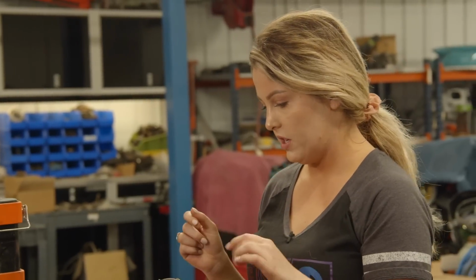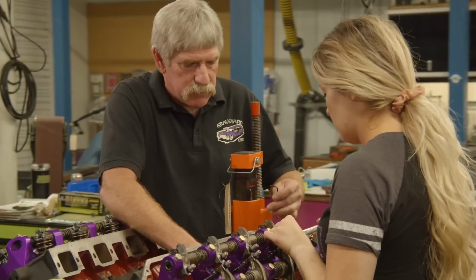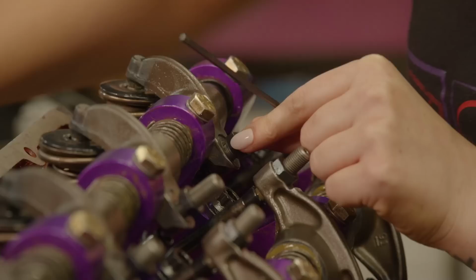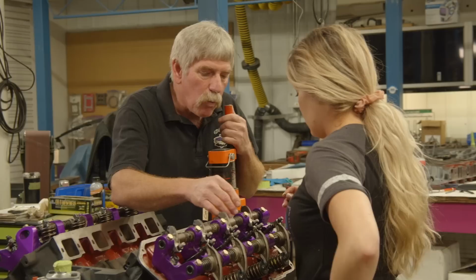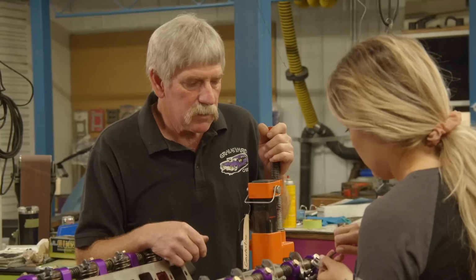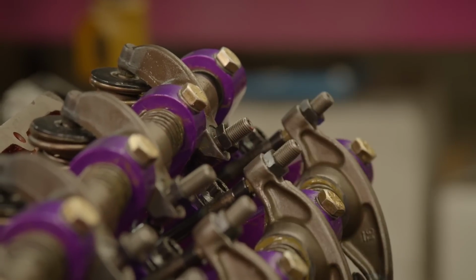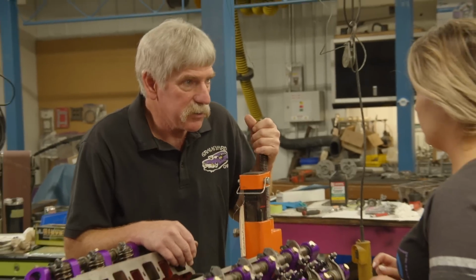So over here. Yeah. This one. You want to back it off? Here's your Allen wrench. Unscrew it until we have some slack in it, and then tighten it down until you feel it bottom. Got it? Mm-hmm. Okay, so we'll turn it 1.5 turns now. Can you see the red dot on it? I can, it's straight at the bottom. It started straight down, the red dot, so I took it 1.5 turns. Okay, great, perfect. Now we'll lock the jam nut.